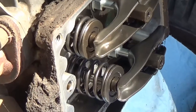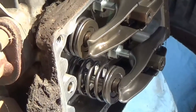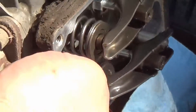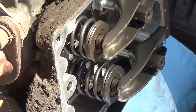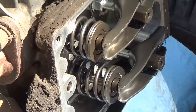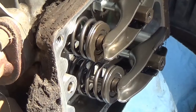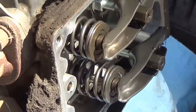Now you've got your valves moving — you've got your exhaust and your intake. We're turning the motor over. You've got your exhaust going down, and then your intake is starting to go in. When it comes back up, you're going to see it just slightly move back — it's going to push the valve in just a hair. That's the compression release. You can see it moving slightly, just popping right up and down. So we know our valves need to be adjusted and that should cure the whole problem.